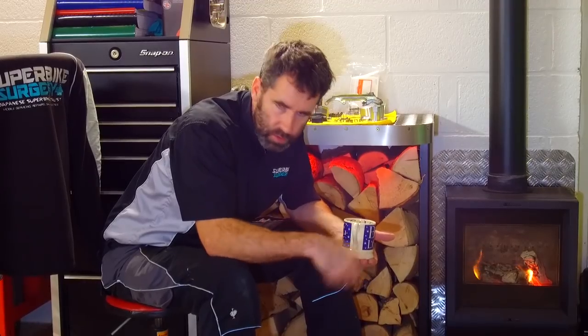That's sometimes not a flat battery, that's sometimes a bad connection somewhere, either a loose battery terminal or a bad earth, from the earth strap to the back of the engine from the battery. But in this case, this is a flat battery, and we're going to explore charging systems in this video, how they work.